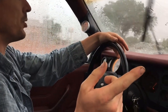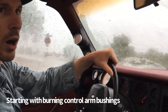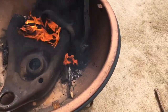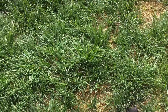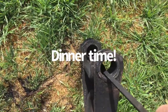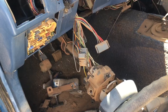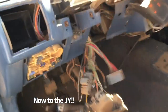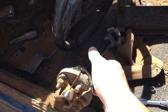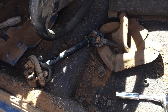I'll go ahead and show you — I've vlogged some of the install process. I fought with these control arm bushings for a little bit and decided to burn them. Yeah, this worked like a charm — got all the rubber out of there. I got the bushings most of the way pressed in. I dropped the steering column, then was able to get the old steering U-joint out. A little tougher than I thought, but I didn't know what I was doing either — so the first is always the worst.